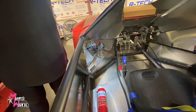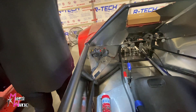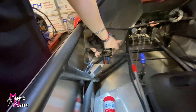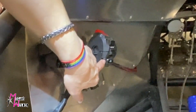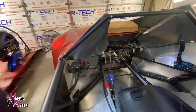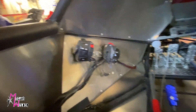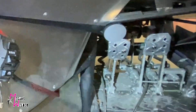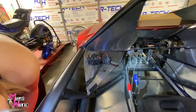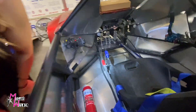The horn will be there, hazard lights, and the start/stop button. Being able to start the motor, I was able to do that with the starter from the handlebar control. The brake switch and the clutch switch — I have switches that are literally on the foot pedals. Those switches have a little sub-harness that talks to the hand controls, so the hand control tells the brake light when to come on, or whether the clutch is engaged or not.